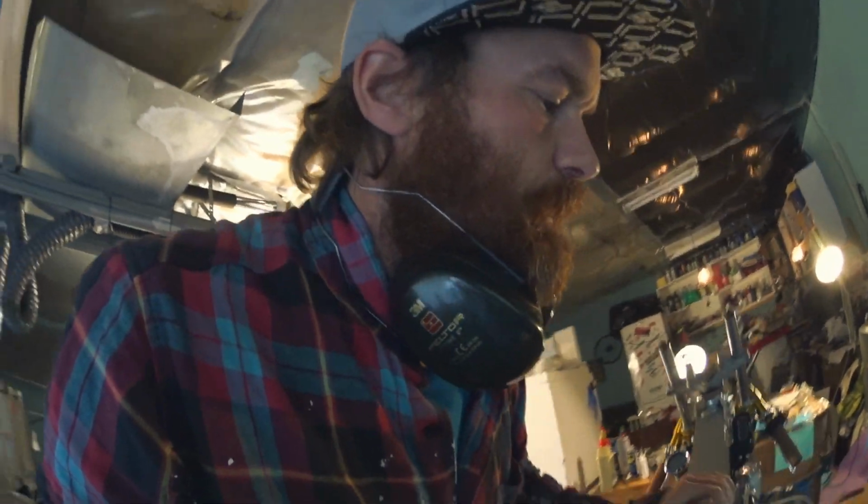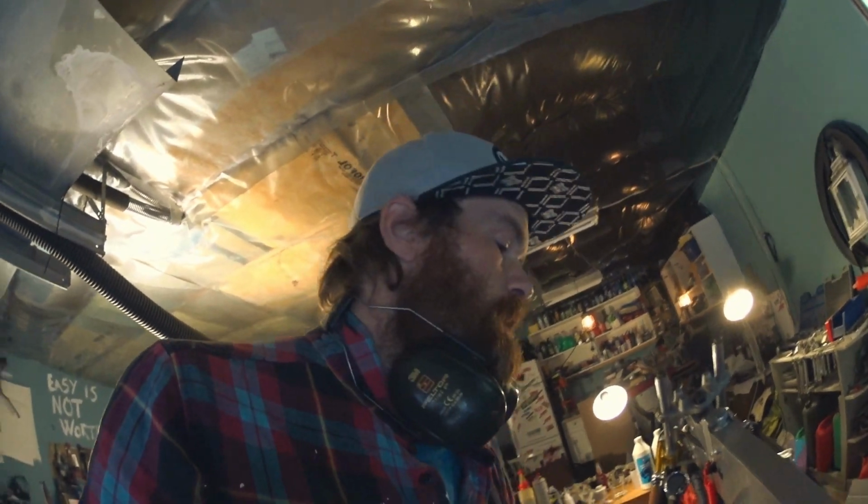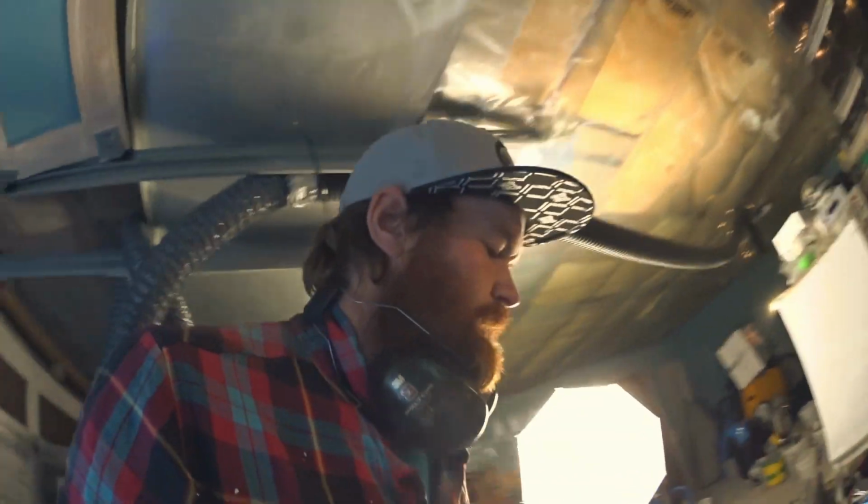And also now I'm running the battery at around 14 volts. It's 3.8 volts per cell, I think. I charged it to 3.9. I can easily charge it up to 4.2, and I will have a little bit more voltage to multiply in the secondary winding in the coil. This is TCI, so the primary coil is always connected to the positive side of the battery. Then, for a short period, in this case I think 30 milliseconds, it's grounded for the primary coil to charge up, and then the ground is broken, and this causes a big spike in the primary winding, which leads to an even much larger spike in the secondary winding. Okay, this wasn't meant to be a lesson on coils.